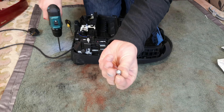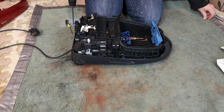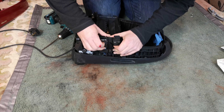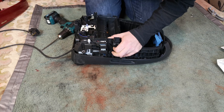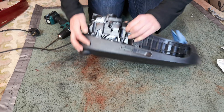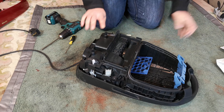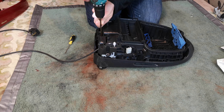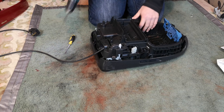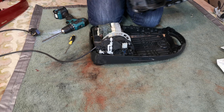It's quite rusty, you know. There's a couple of rusty screws - oh yeah, this back one here. I'm bleeding! Don't get blood all over the customer's vacuum. Multi-plug out, but then there's a screw under there, a screw in this back corner. And then this part lifts off.